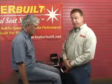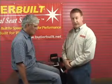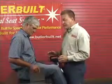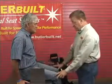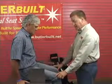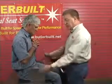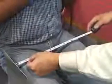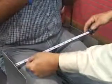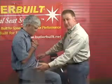The first measurement we're going to take is across the hip area. This helps us generate the actual width of the seat bottom. The procedure that we follow is to sit in a nice, comfortable position where the knees are spread just slightly, just like you would be sitting in a race car. The measurement is actually across the widest part of the hip, right in front of the groin area. In this particular case, we have some panels set up against the side of the hip where we can literally bring a tape measure across from side to side to generate that exact width of the hip.